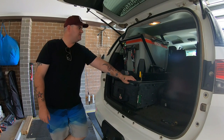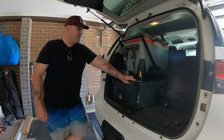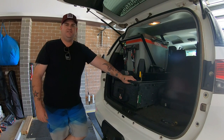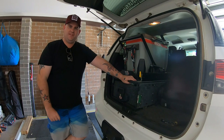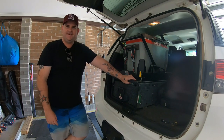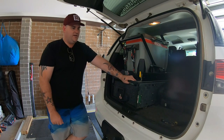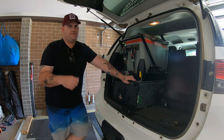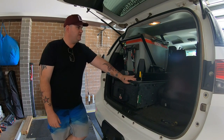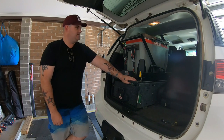It's no secret that I love a beer while we're out exploring and touring when we pull up to a beautiful beach, so it's definitely time we've got a dual battery system. I know what you're thinking — how have I gone all this time without running the fridge constantly? Well, I've got a couple of tricks. With the old setup I always run it a little bit colder than what I want, and if I'm going away for the night I was always throwing frozen water bottles in it. So with the new dual battery setup we're just gonna leave it running and we're gonna have no issues with it.